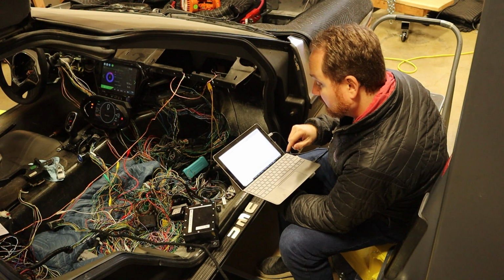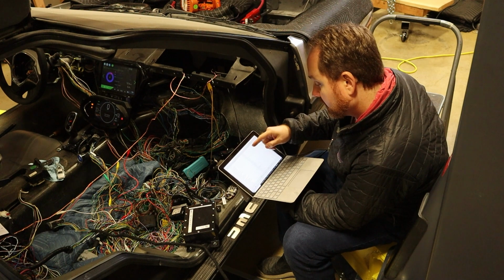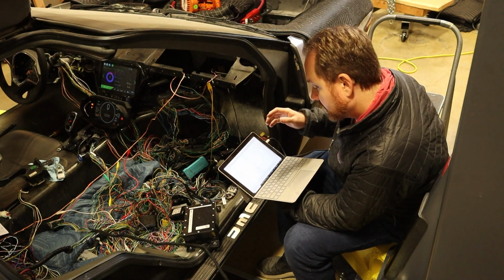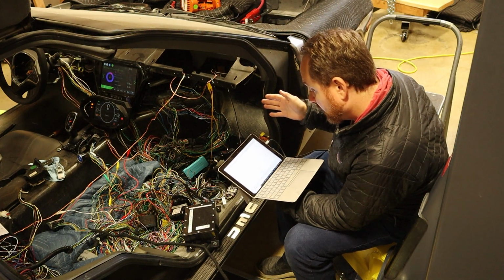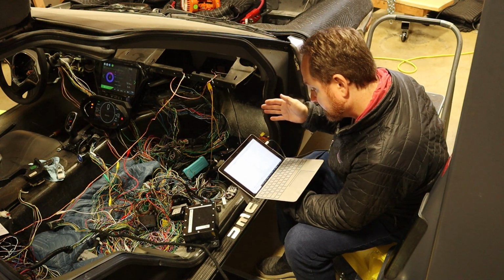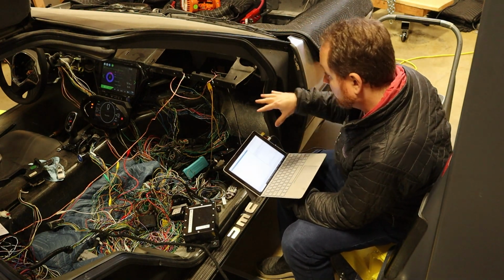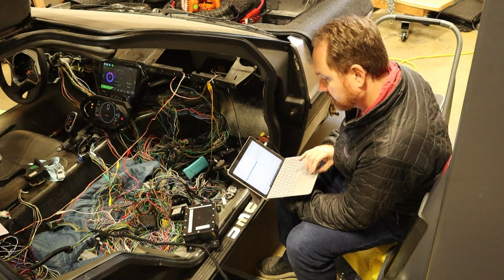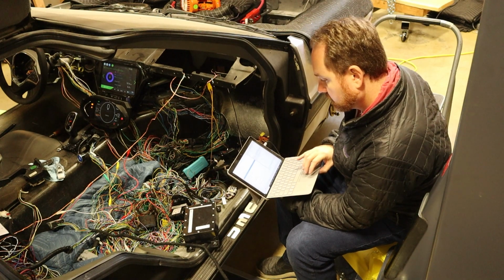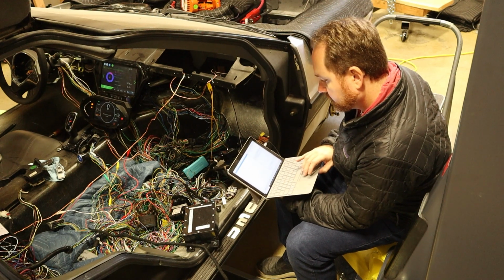It can't communicate to the power steering control module, which makes sense because it's not plugged in. All of these other ones, it's connected to. Passenger presence module, no. Video processing unit, no. Yes, almost everything is on here. This is fantastic. And the main one, the battery energy control module. I plugged the BMS in under the car. So now I'm going to go under here to module diagnostics, and I'm going to connect to the battery energy control module. And let's do data display.